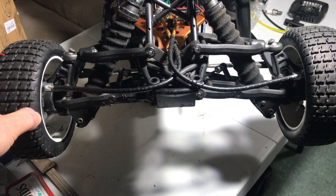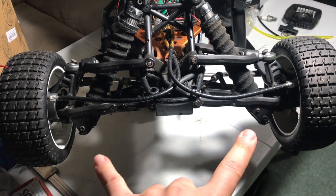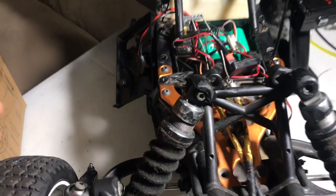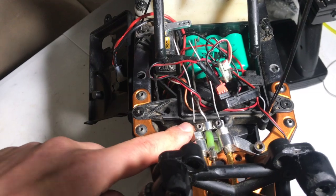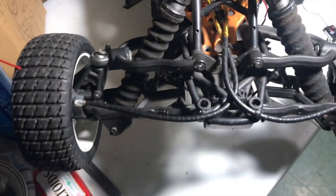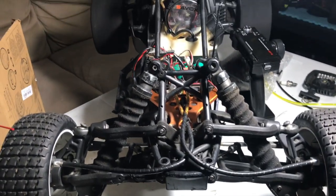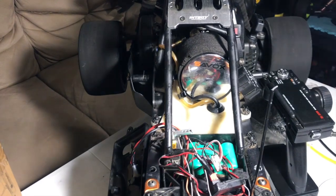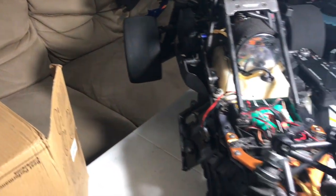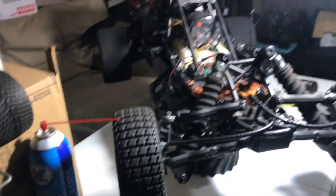Generally, these mechanical systems, one of their major problems is getting the left wheel and the right wheel to brake exactly the same. It's just really a factor of geometry. Now, I have it set more or less correct based on how I had it before, but this is one of those things where you have to literally test it out in the field. But yeah, guys, so far, the radio system seems to be okay. This should be good. I just gotta get this thing back together so it doesn't look so freaking sloppy, and then we'll be good to go.